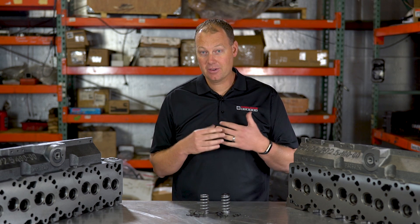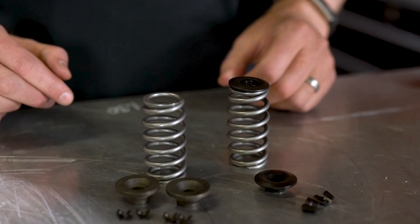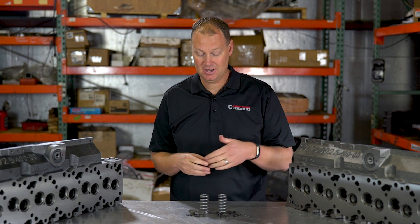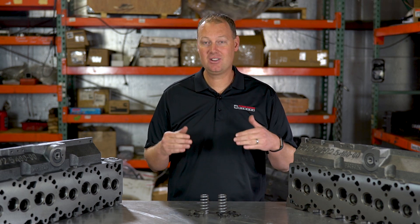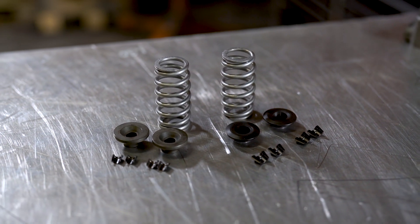People have taken this spring higher than 4,200 RPM, and you very well may be able to as well. But for me, if I have a build that I want to work over 4,200 RPM, that build is big enough that I'm willing to spend a little more money on springs. This tool steel lock and retainer setup retails for $200. When you add that to a $150 spring, you're $350 into a set of springs that's really reliable and actually pretty high performance — 4,200 RPM and below, this setup will handle it no problem. That's enough RPM for 750 to 800 horsepower. It's $200 cheaper than a set of conical valve springs. The conicals are much better, but they just aren't needed for a lot of guys. We wanted to offer a good option for budget-minded people who don't need the 1,000 horsepower, 5,000 RPM capability.